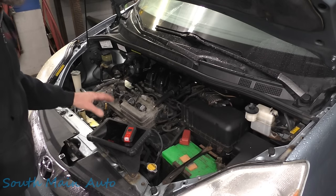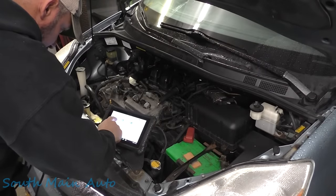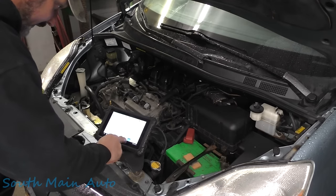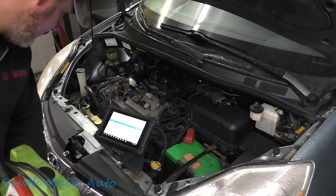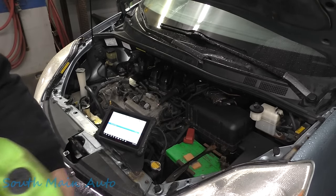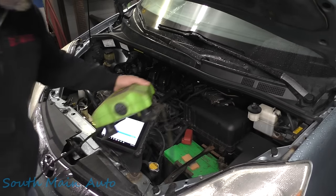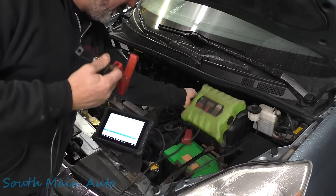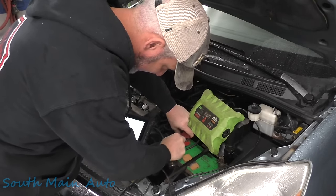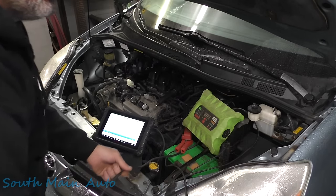I'll show you a little bit how it cranks - I just want the starter to cool down a little bit. We'll throw a battery maintainer on it and let it do a full system scan. It looks like three codes so far in the engine computer - that's all we're really kind of worried about. He told me on his note it was a P0340, which would be a cam sensor. I've seen cars with cam sensor failures that have extended cranks, but this thing was really excessive to the point I was just about ready to give up and push it in.